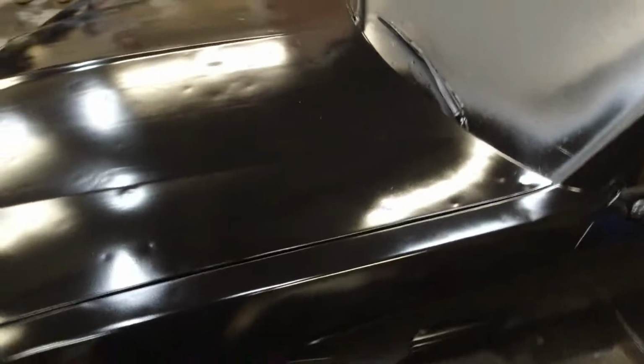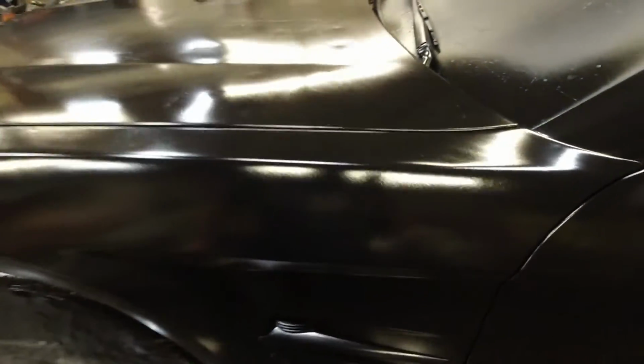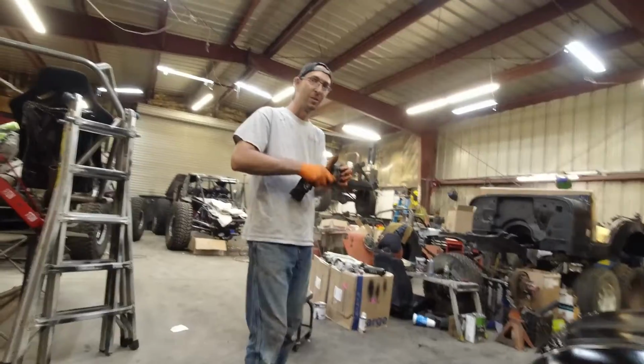The bright side is, now that this is starting to dry out, there's a little bit of orange peel in there. Once it's dry, we'll buff it. And like I said, we did cut it a little thinner. But the wet sand definitely helped a lot. It's a lot smoother, it's a lot flatter, and it's not too terrible.